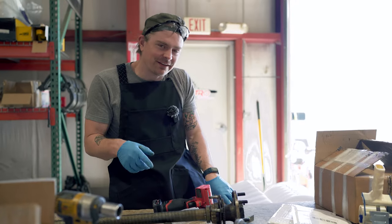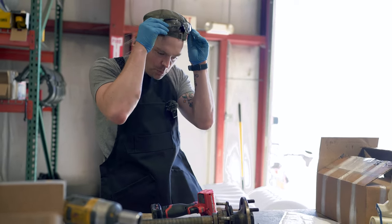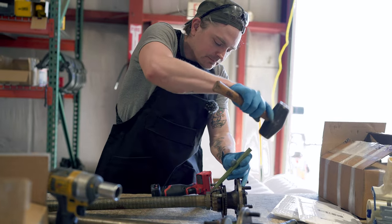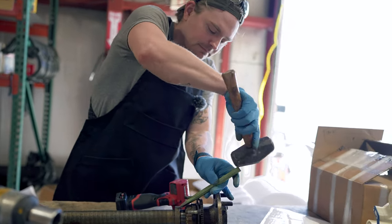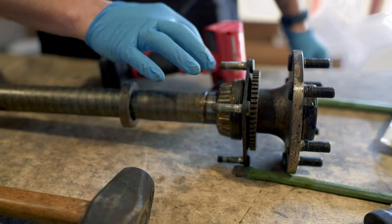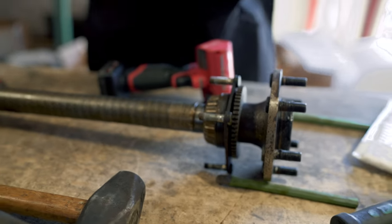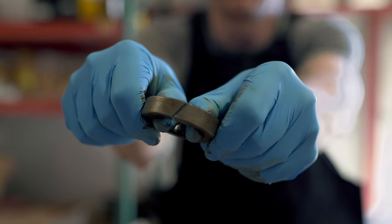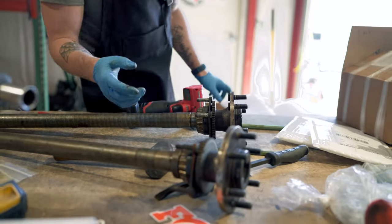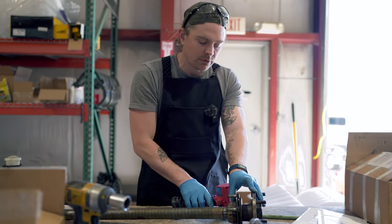As I got close to the very bottom, it relieved its own tension — it just popped itself open, which made things easy. I don't have to worry about nicking the axle shaft and now it should just come right off. That's your spacer ring, and look — no damage to the mounting flange. You can actually see a fracture or a crack in there. Now we're going to do the exact same thing: cut through the cage, get the cage off, and then do the same thing to the inner race.